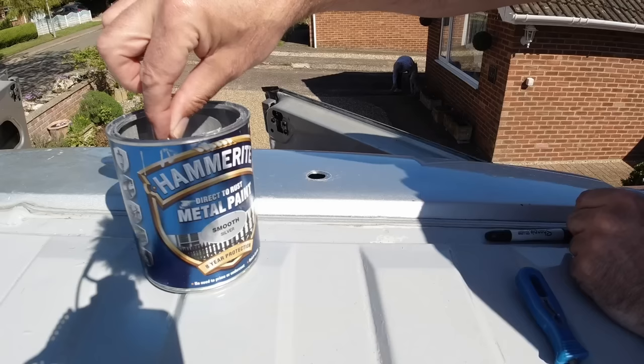And then obviously once you've got the other bits and pieces on there, a couple of washers, and then simply bolt them down. And as you do up these nuts, that pulls that bottom plate up to the bottom of that little T-nut, and basically drives this one down, pulls the bottom one, the inside one up, and sandwiches it all together tight. And it's a really good, convenient, really easy, simple fixing.